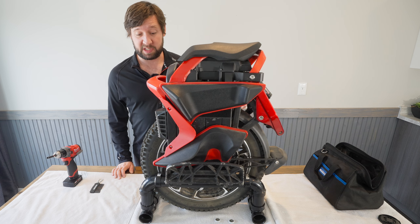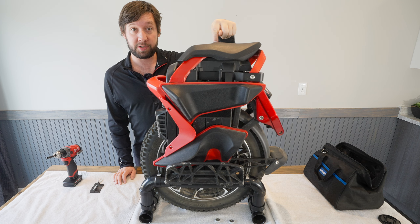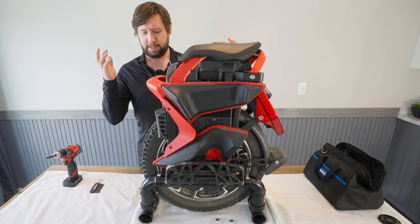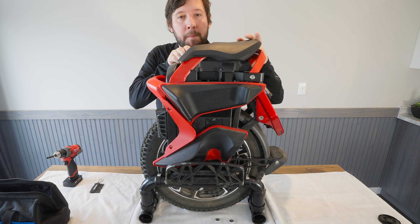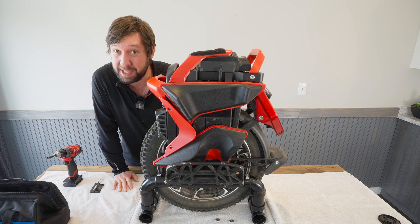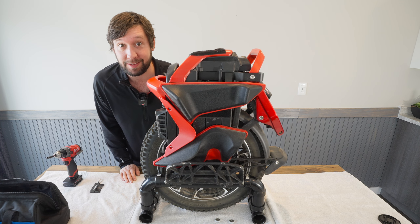This procedure is basically just like changing a tire. We're going to remove the motor, so we have to get to the motherboard, take the whole sensor wires off and the motor wires, then take a couple bolts off the suspension, and in theory the motor should slide right out. Sometimes being an adult is very stressful, but if you get your own place, you can work on wheels in the dining room and nobody can yell at you. It's pretty sweet.